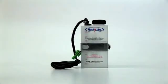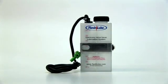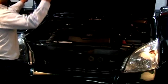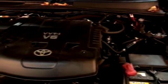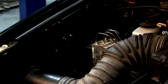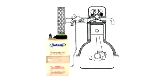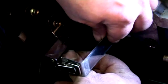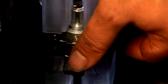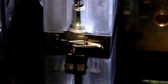To begin installation of the FlashLube electronic kit, find a suitable position in the engine bay away from areas of extreme heat, ensuring the reservoir is mounted no higher than the lubricant inlet port into the engine to eliminate the possibility of siphoning. Mount the cradle using the two self-tapping screws. Position the bottle in the bracket and clip the latch around the bottle accordingly. Do not fill the bottle at this stage.